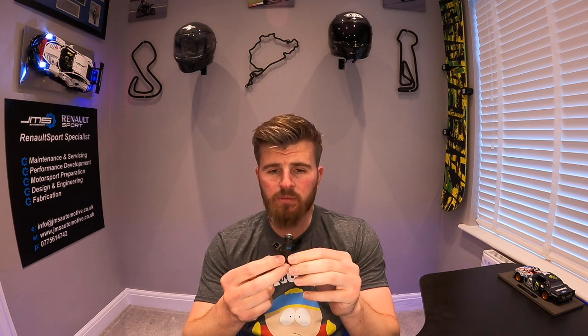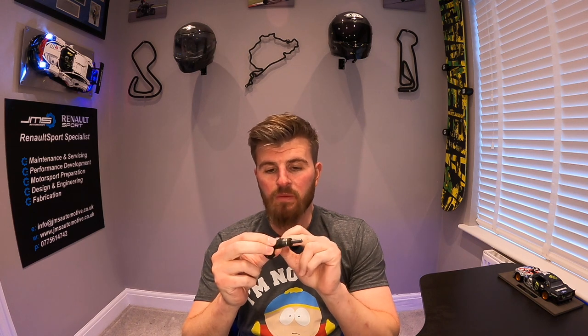So what causes these to fail? You have one per cylinder, so in a V8 car like the E92 M3 you have eight of them. I actually haven't found any solid evidence as to what causes the failure, but I've seen enough to know that they do fail. There's talk that because the E92 doesn't have a separate fuel filter — there's just one built into the tank — particles get in and it gets stuck. I'm more with the idea that there's something like a coating on them that wears down, and eventually it starts sticking. Obviously when you're in fifth or seventh gear, flat out at top RPM, these are working pretty hard and fast. For what these cost to replace, and given that my car's a 2011 with 74,000 miles, I was happy to get them changed.